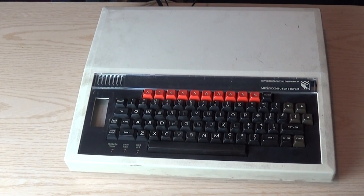Now to try it out — let's see if it works. So now we've got the BBC set up to my capture card. That's a very good sign — it says 'Smart SPI'. It didn't say that before, so that must mean the IC is correctly fitted. So if you don't see 'Smart SPI' on your BBC Model B, then something's not quite right.